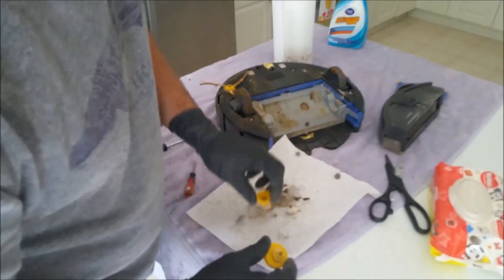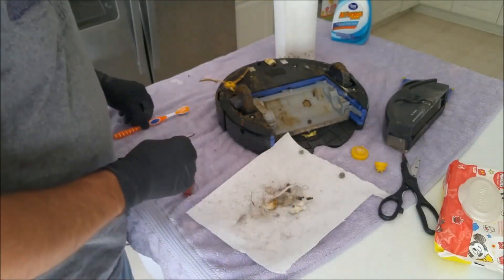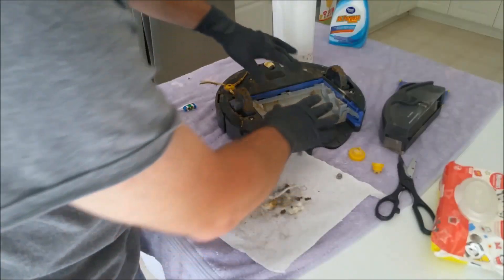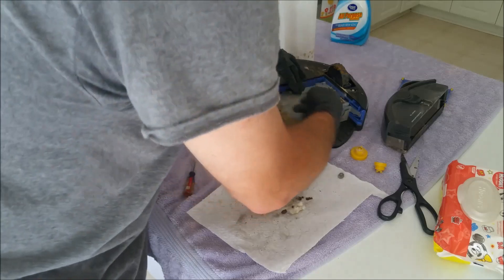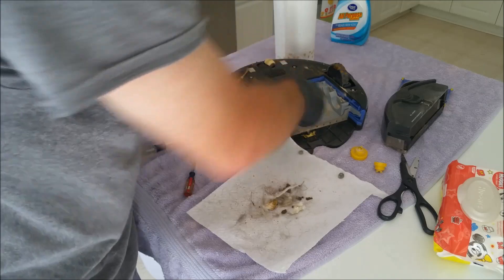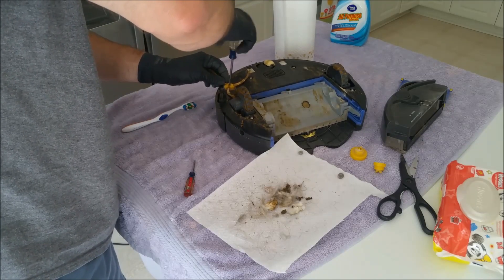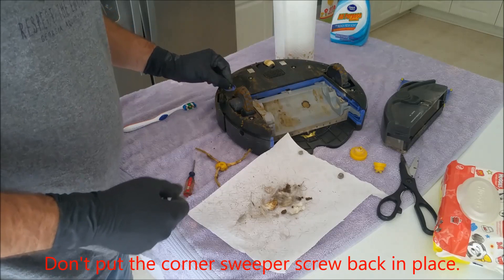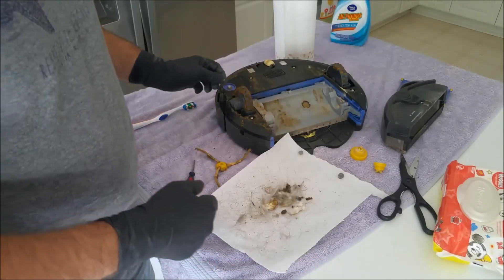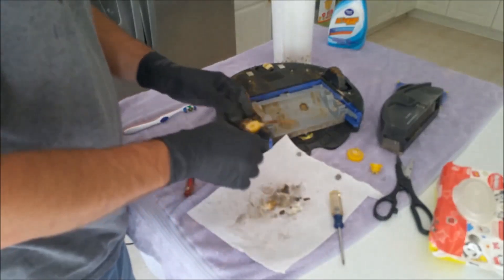These caps — if they are not impacted, I'm probably not going to throw them in the sink. They have pre-oiled bronze bearings, so I will probably clean them with a toothbrush. I'm not going to pull out the vacuum tray assembly — it's unlikely that we have any fecal matter underneath it. I am going to remove the rotor brush. One little tip: you'll be tempted to put the screw back so you don't lose it, but it gets tight enough that you can't back it out without rotating the piece underneath. So put that in a safe place.